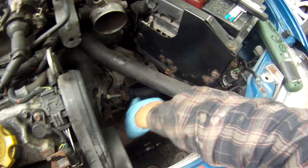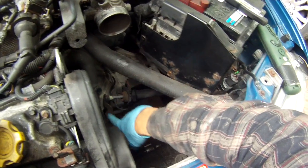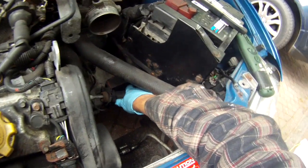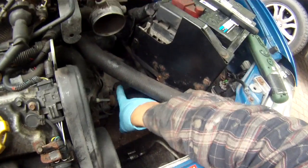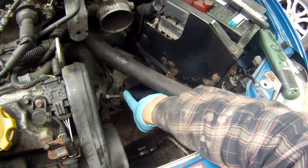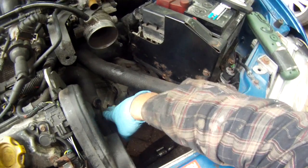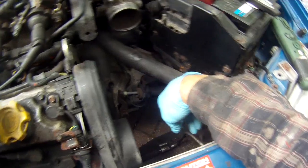the pedal is pressed, so this arm is activated, this is the clutch arm that activates the clutch inside the gearbox. What you'll find is this slave cylinder starts moving around, and it's caused by this plate being rather weak, and you can get a little crack where my finger is along here, which means this bit bends back further. The clutch slave cylinder is then too far away from the operating lever and isn't able to push it far enough to fully disengage the clutch at the optimum position.